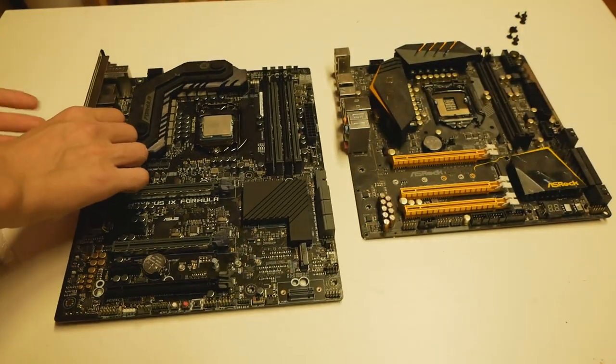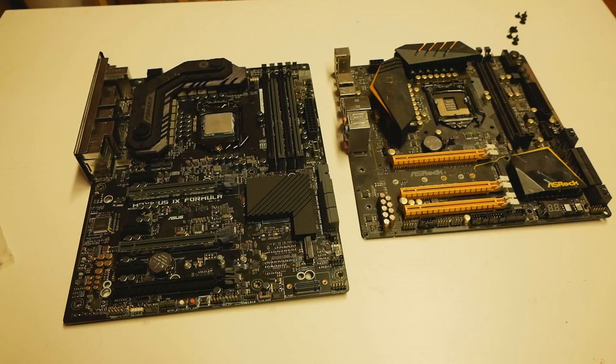Some guys even used a flat-headed screwdriver to connect the two pads together while doing the USB flashback process. I quickly tried that way myself before soldering the pads together, but it was quite hard, and you might accidentally short something else together. So I think the safest way is to use proper tin solder to connect the two pads together, and you can just leave it like that after that. You don't have to remove that solder connection after doing the flashing process.